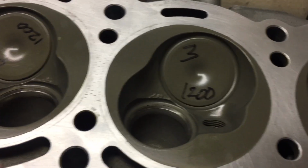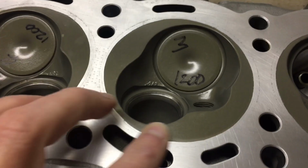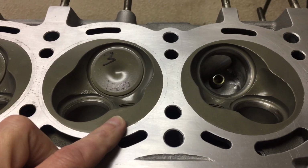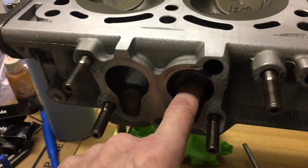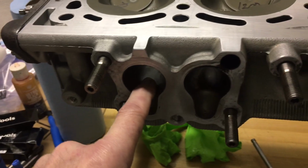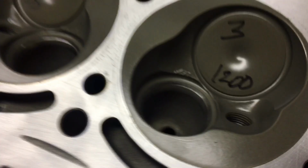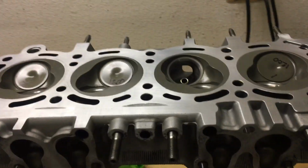Like I say, real pleased with how the Cerakote coating turned out, and I'm looking forward to seeing how this stands up to carbon on both the chamber as well as the pistons. And I'll be curious to see if the motor has any lower operating temperatures due to having the exhaust runners and ports coated with the ceramic. Even though I have to say coated poorly, from a functional standpoint, I think it's going to do the job. So, okay, that's the latest.